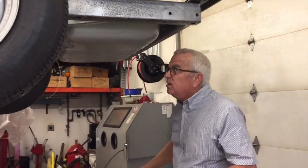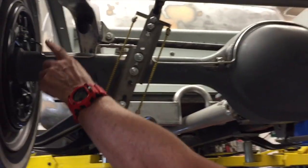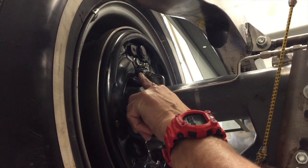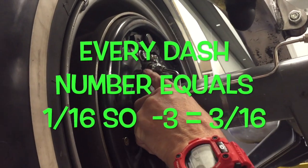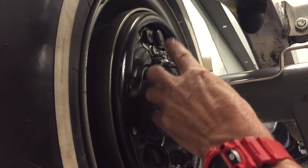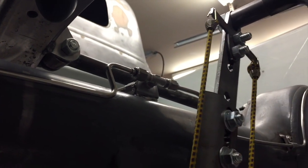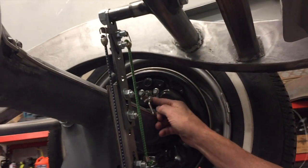Let's start at the back of the truck. I used stainless line, which called for a dash-3 fitting. This adapter here screws into the wheel cylinder and goes from the 45 double flare to an AN-3. It comes along here, goes into a T, then down along the axle housing, up and over the hoop, and over to the other side.